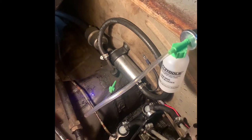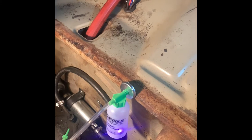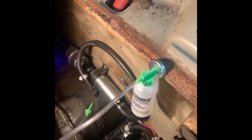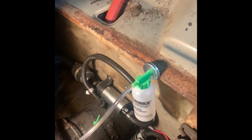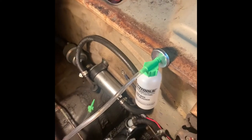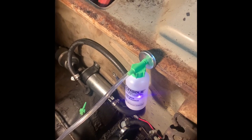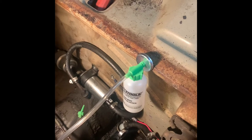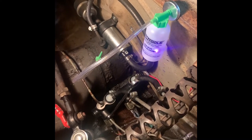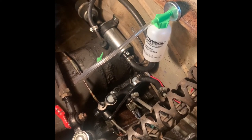Move to your next wheel with an empty bottle. Connect it all up, loosen the fitting, put your hose on it, then pressurize your reservoir — keep it at really low pressure, about five to ten pounds — until this bottle fills up halfway at the next wheel. Take it off and tighten up the brake bleed fitting; you're done with that wheel. Do all four wheels like that — start with an empty bottle, push air through until it fills halfway, then dump the bottle and move to the next wheel.